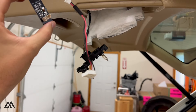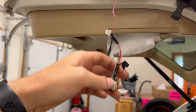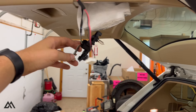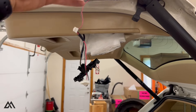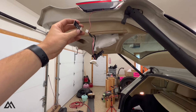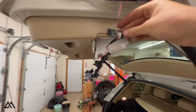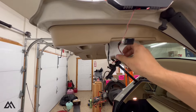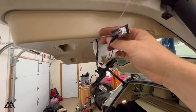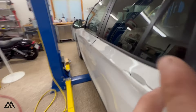I've got this resting up here and I'm going to install this, which is simply just plugging it in. It goes in series with this wire that then attaches to — I believe — the power source. So it's coming from here, through here, into the chip, and then into the LEDs. Let me plug this in and we'll turn the vehicle on and see if that solves the issue. I've got this plugged in here, coming from this connector up to the new chip, and then up to this LED. We'll just have to hit the ignition switch.